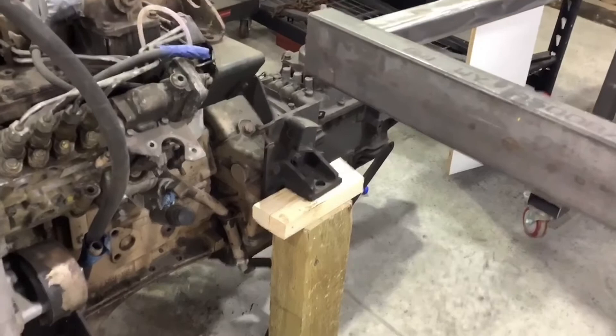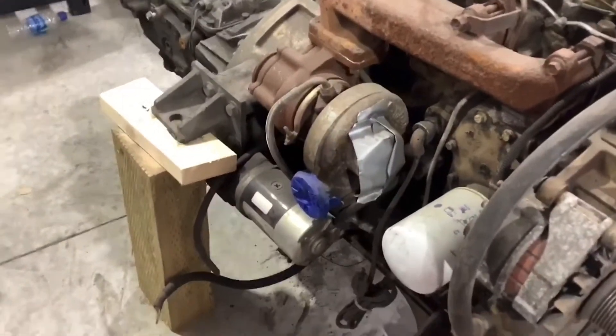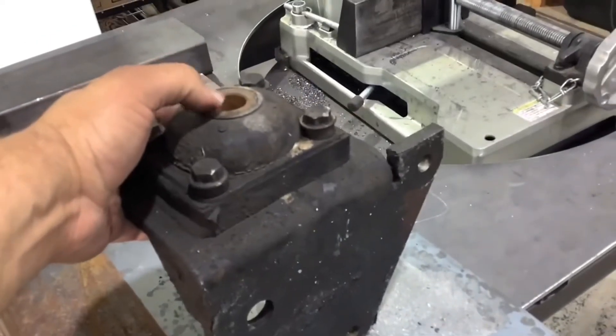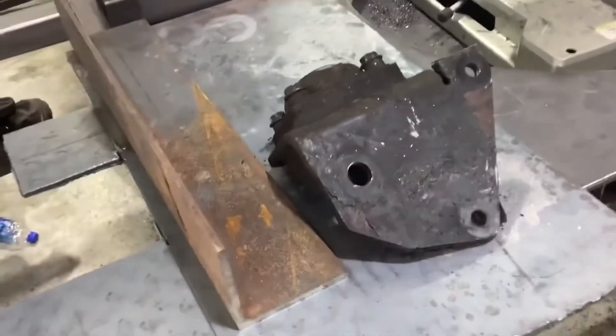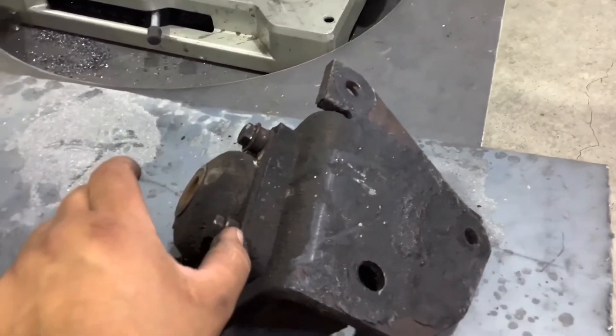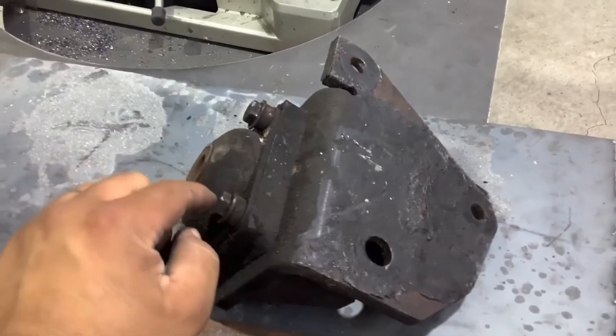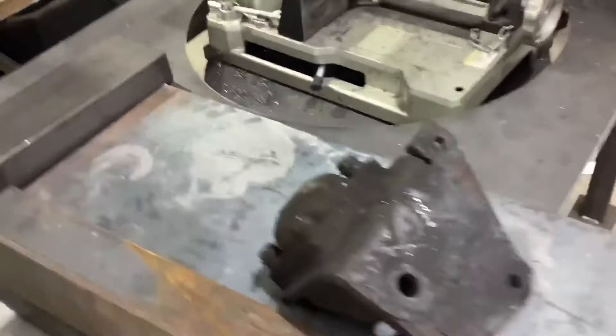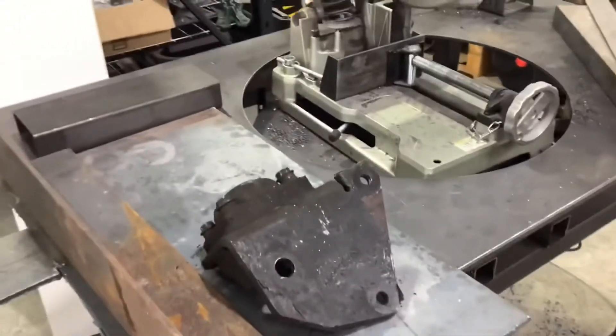Here are the rear mounts. If you look at the engine you can see how much higher that rear mount is. I thought I could just lower that rear mount down — I could remake that mount, drill the holes, move it down about six inches — but on this side I've got the starter, so I can't move it. Here's our rear mount and it fits right inside the frame, so the top is going to be about three inches shy from where I need it. My plan is to add three inches — probably go with a three-inch schedule 80 pipe, then a flat plate, and run long bolts all the way down through all of this.